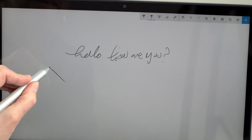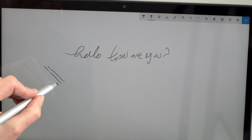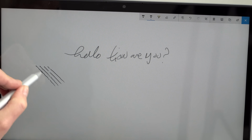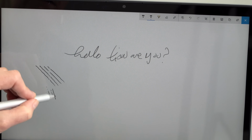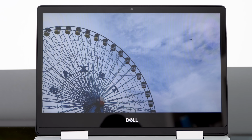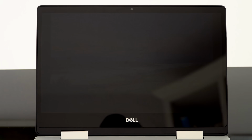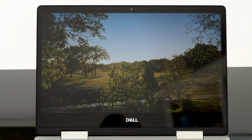It's decent. You'll see some jitter on diagonal lines. Palm rejection's okay, not super fantastic. That's just the way N-Trig rolls. It's decent enough. It's fine if you want to buy it for note-taking, diagramming, and all that sort of thing. So the not so hot news is it's a very glossy display, and that's not unusual, but it's also not a very bright display. Maybe in part because Inspirons have never had the most fantastic battery life, but this is only 200 nits. So for those of you who are planning on working outdoors, this wouldn't be your choice. You want something with a brighter display.